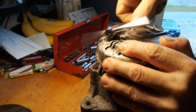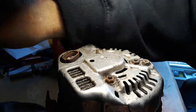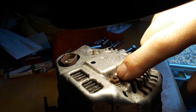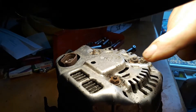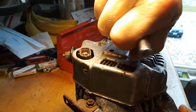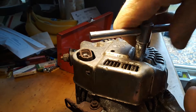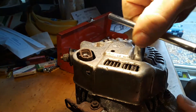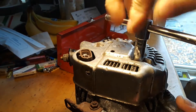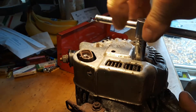It's a little crusty on the threads. If you look at this thread, I'm starting to take it off — there's some crust on the top. Now, if I try to run that nut all the way up, I'm just going to be trying to plow over that crud. But sometimes when you're taking a nut like this that's a little crappy off, turn it back until it's kind of tight, then turn it forward. This is especially helpful when you're taking spark plugs out — sometimes carbon builds up on the threads and if you try to run it through, you can strip the thread out. But if you give it a little bit of back and forth, it allows some of that crud to flake off, and you can often get it off without breaking anything.